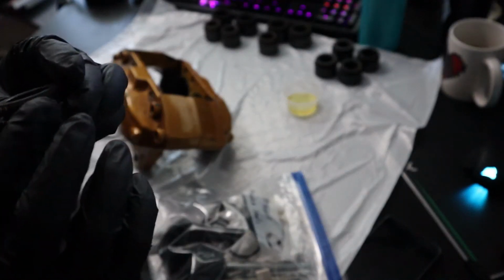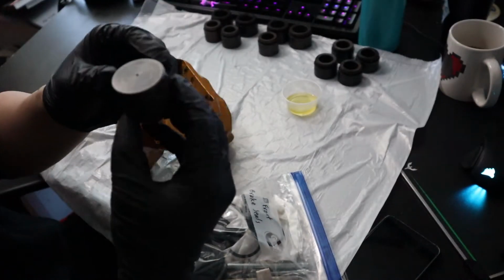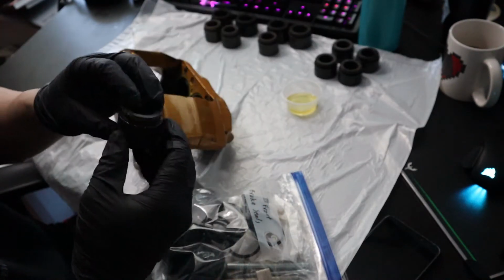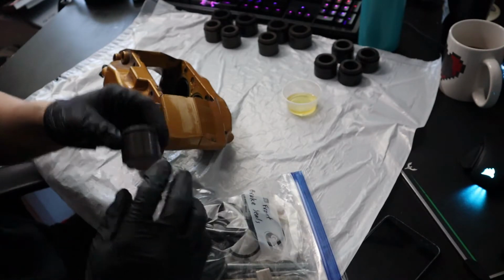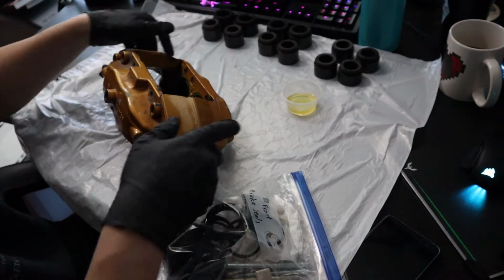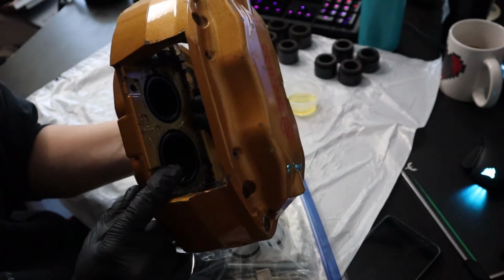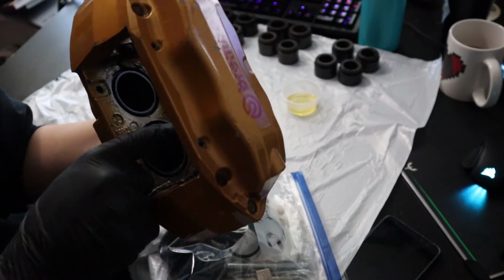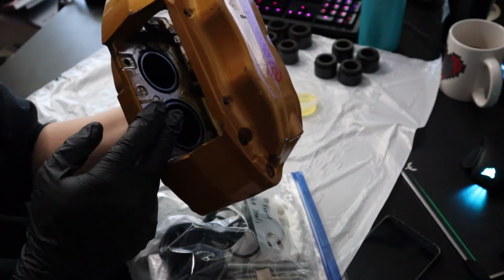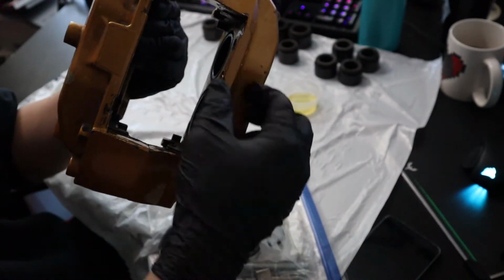These scratches are very superficial. They're not too deep, and it won't prevent the sliding action from the piston or in the caliper. So we'll just run them. But yeah, the other ones came out pretty easily. The trick to getting all 4 pistons out was to reseat one of the pistons and put a clamp on it, or I've seen some people actually zip tie them so they don't fully escape out, and the air pressure can go to another cylinder here and pop that one out, and then you repeat the process for all of them.